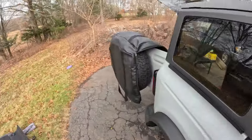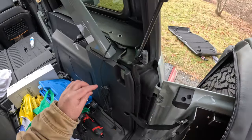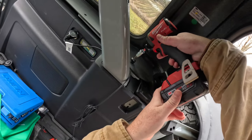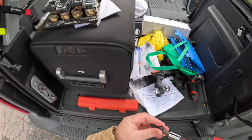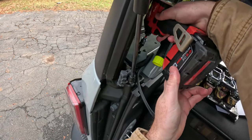All right, we're close. Let's go ahead and spin these hard top bolts back on real quick, and then we'll torque them appropriately this time. Am I on the lowest setting? Yes, okay. It's pretty easy to rip the threads on this, so if you're gonna be using an impact like I am, lowest setting, definitely use the lowest setting.